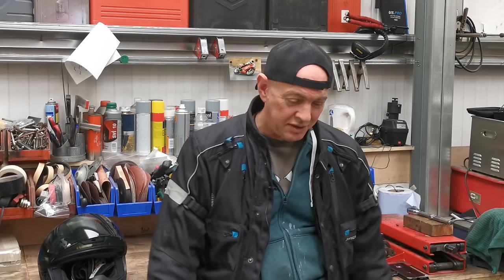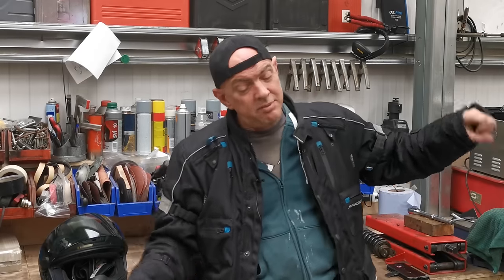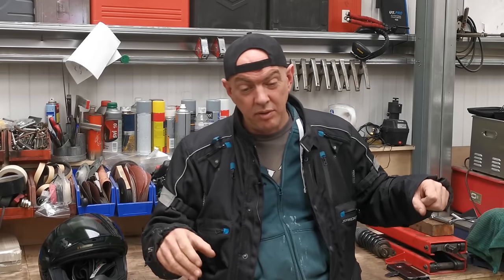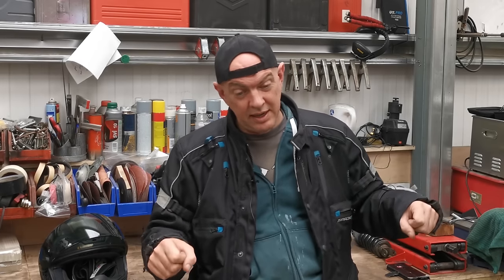Go really heavy on the brakes and the front end just falls away from you and the back starts getting a little bit light. Static sag, we've still got 5mm in the back. Laden sag, it's 43 on the back. But the front is just too spongy for it, basically. And if you're tipped over on a corner, accelerating through it on an uneven road surface, you do feel it through the front, and you can feel it's not tracking like the back does.